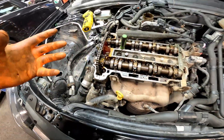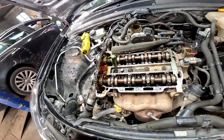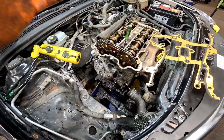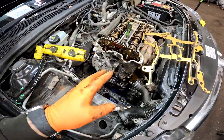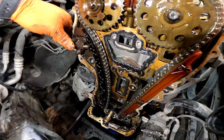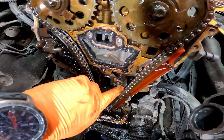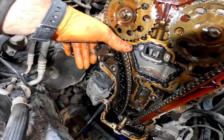Once we've got that engine timed up with the crank locking pin and the plate in the camshaft slots, we can go ahead and remove the water pump and then get the timing cover off. Over the years I've done so many timing chains - I use an old timing cover gasket and put each bolt back in its hole so you don't get them mixed up. That is the timing cover off now. This is probably one of the worst ones I've seen - it's actually worn the guide away and caught the side of the block and the head as well. This has been rattling for a long, long time.